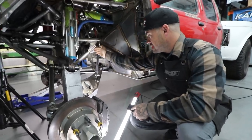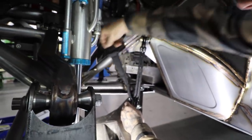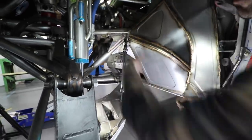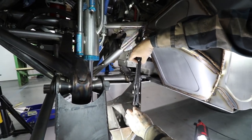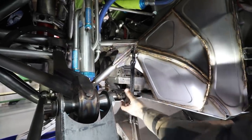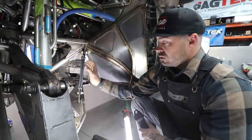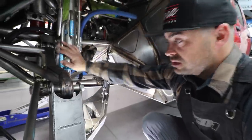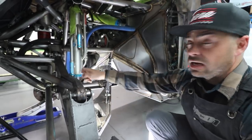Try to get your mounting where it's at an optimal angle. You don't want to have the strap mounted to the arm and then twisted. When they're mounted in closer, they're going to stretch more and be loaded up a lot harder than if they were further out on the car. Think about the stretch, think about where it's at. Always mount these things accordingly where you're not letting the shock fully extend — cinch it up whether it's an inch or an inch and a quarter. That's going to make sure you're safe and not hyperextending these things.